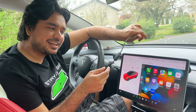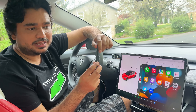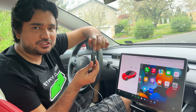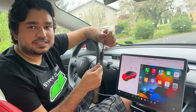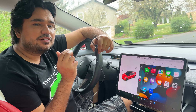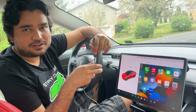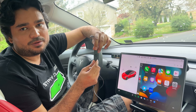A workaround is a system with a little switch where you can turn it off right before leaving the car — that way your phone won't be connected to CarPlay while you're inside the house. When you enter the car, turn it back on and you have the connection. That might actually be better because it would also solve some of the Wi-Fi pickup issues when you turn on the car. One more thing with that Wi-Fi: make sure your home's Wi-Fi is not competing. If your home's Wi-Fi is competing with this device, CarPlay might not work. Once you move away from home and the home Wi-Fi is no longer in reach, this Wi-Fi should be picked up by the car.